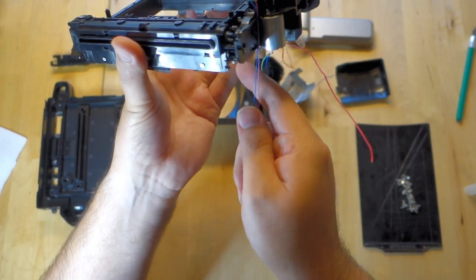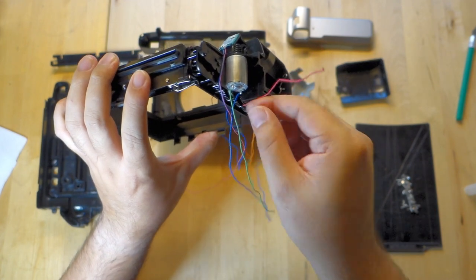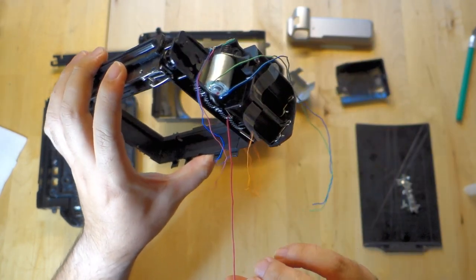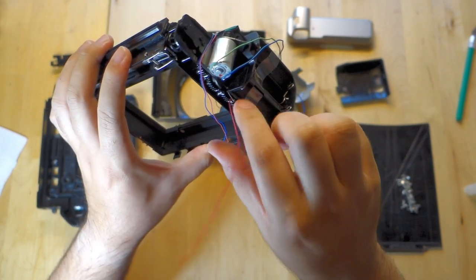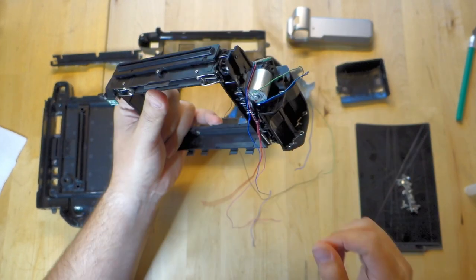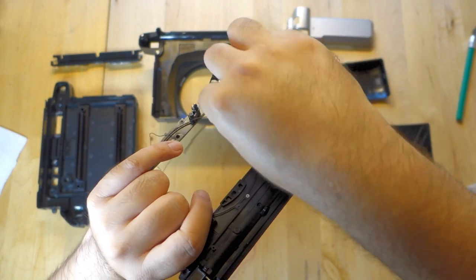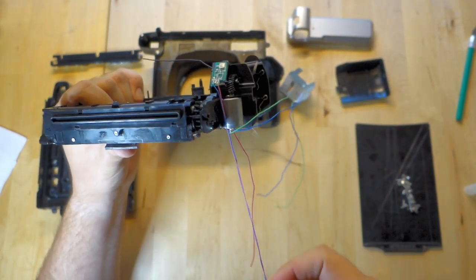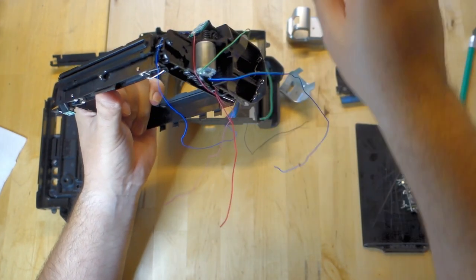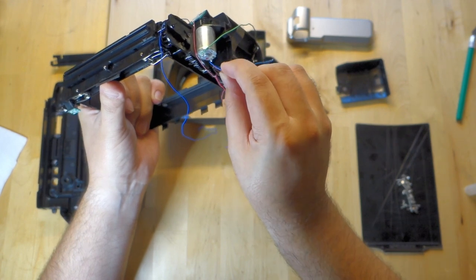Your pink and your blue you could just dress them down next to the motor. We have a green and a blue coming out of the motor — we're going to remove those but I'll leave them on for reference. Then we have this darker pink that is your positive from your battery compartment. The two orange wires you don't need. Connect the two blacks together, then connect the blue wire to the green. Remove this green up here — that's where the blue would be connected. Join the two pinks and connect them over to where the blue wire is on the motor.